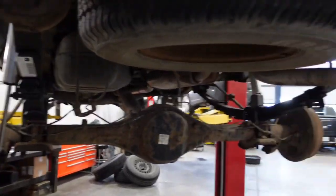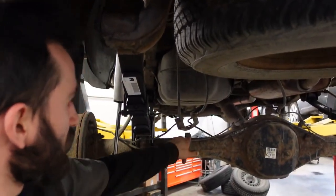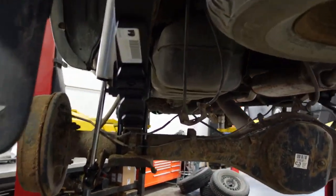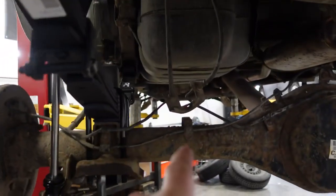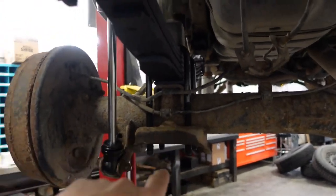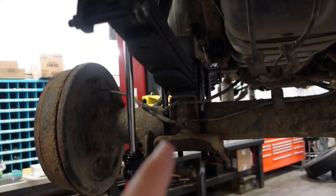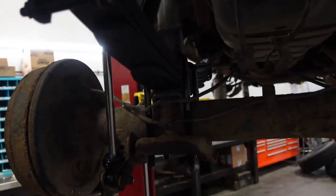So we got the rear end in. We have to build some sort of bracket for the brake lines because they're gonna be stretched. Look how stretched that is. I even loosened it. I'm gonna have to put something there. Yeah, so the kit doesn't come, for viewers that are looking to do this, the kit doesn't come with anything there. Now, let's point something out from the kit, is that we did end up finding the U-bolts in the kit in a different box. Convenient, they don't put it with everything else that goes with the rear end, but we did find the U-bolts. Right, and cool. Then I'm gonna lower it down on the ride height, and then I'm gonna torque everything to spec afterwards. Yeah, definitely get some weight on it for sure.